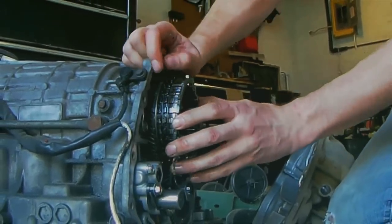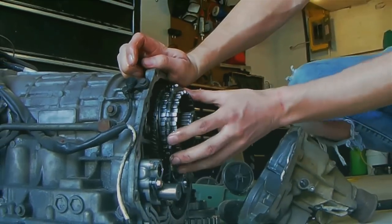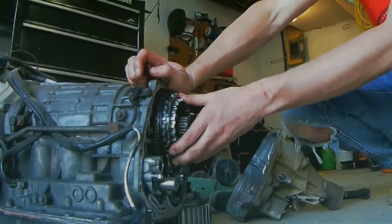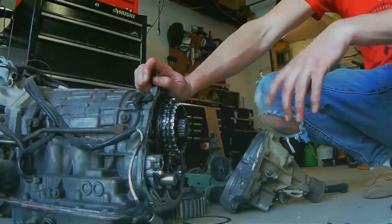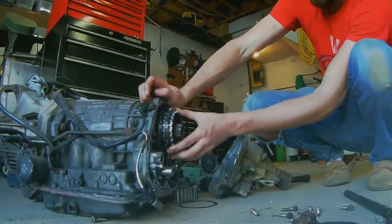Normally there's not much slippage because your wheels are driving at the same speed, so they kind of just move together, but there's no torque transfer. But say you had your front wheels up in the air and you got into the gas - those front wheels would just go ahead and spin, and then these plates would move relative to each other.